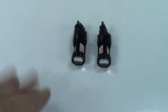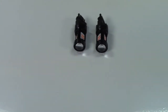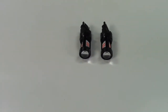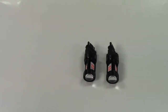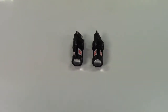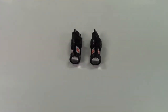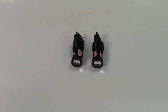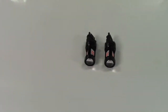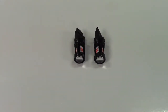We are going to take these out to the car and install them. I am going to install just the left side, and that will allow you to see the difference between the new LED bulbs and the old incandescent. The LED bulbs turn on instantly — as soon as you step on the brake, that light is going to be on. The incandescent takes just a very brief moment for the filament to warm up and produce light, then it fades out when you let go. The LEDs are instant on, instant off. That means the instant you step on the brakes you have brake lights, and that fraction of a second can be enough between safely stopping and an accident.